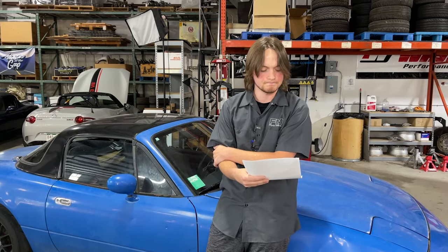Next: is there anything to help drone at higher RPMs, like at 80 miles per hour? Put an exhaust back on your car — that's the easy one. More mufflers or sound deadening in general will help. You might also want to try putting some sound damping material in your trunk, as sometimes you get resonance back there that contributes to drone. But overall, putting mufflers or a stock exhaust on your car will probably help the most.